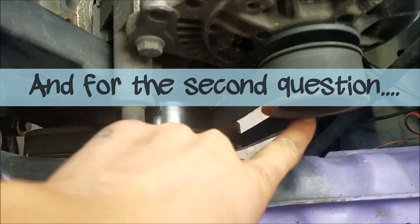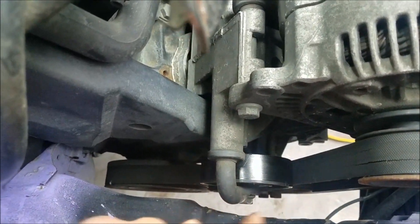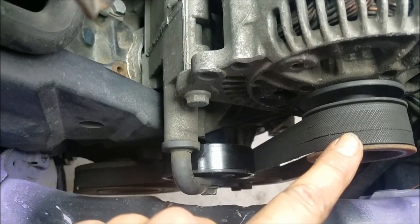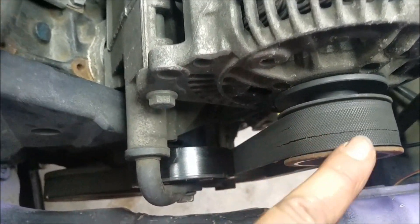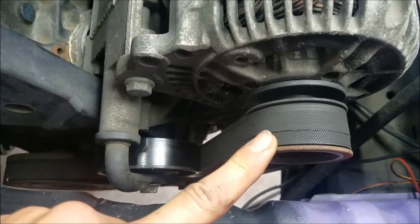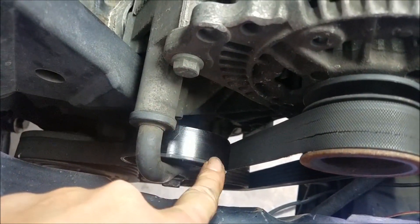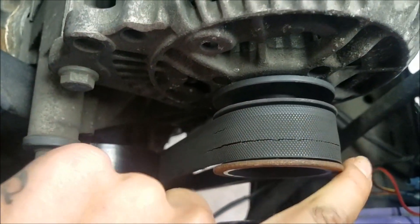With my setup I don't have air conditioning, which normally lives over here, so my belt routing is: alternator to water pump to crank to tensioner, back to alternator. Having those extra pulleys actually changes the direction of the belt and the way it rides over the pulleys. You can see right here I've got some serious cracking on my drive belt. I actually have to replace my drive belt about once every two years because the smooth side of the drive belt is supposed to go on the smooth side of pulleys, and then the ribbed side normally fits into the grooves of the ribbed pulleys like this alternator.